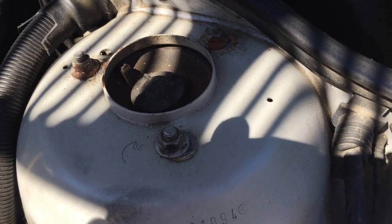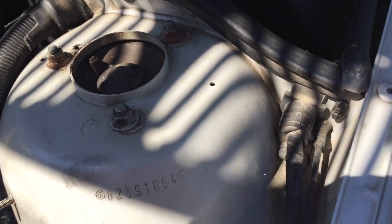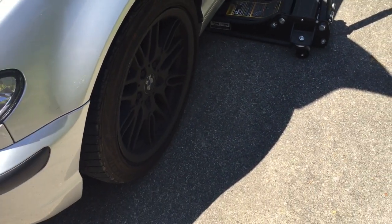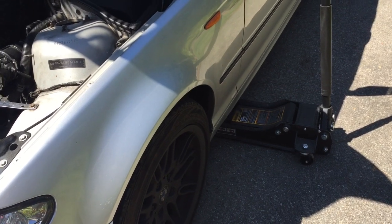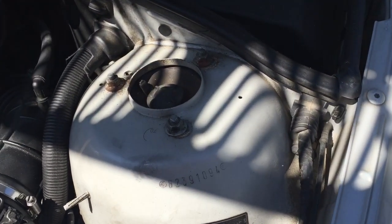This is not a huge camber adjustment, but there is a little bit of a built-in adjustment so you can get a little bit more negative camber to lock in that front grip. What we have to do is jack up the car just enough to take the weight off of the wheel. Once you have enough weight off the wheel, you are going to do most of your adjustments at the strut tower top with those three bolts right there.